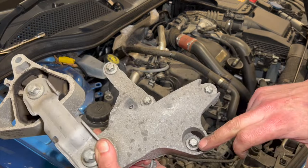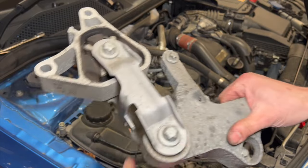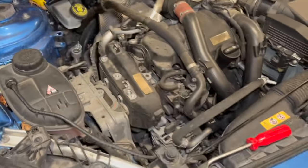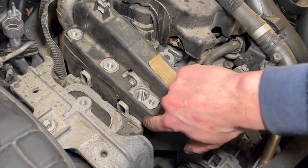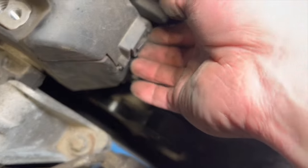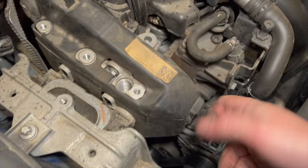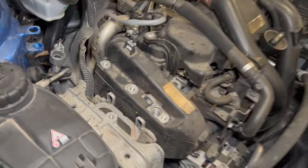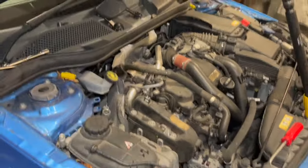The stabilizer mount actually has four bolts on this side. Now that it's out of the way, I'm just going to unclip the top section of the timing belt cover from the lower piece — it's just held on by a couple of little tabs that flick off on either side and on the back edge. Then we'll send it up in the air and get the driver's wheel off.